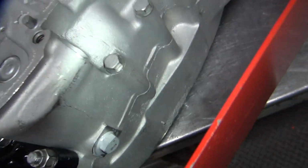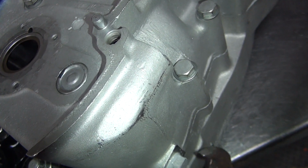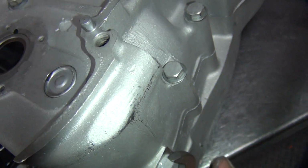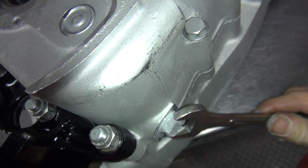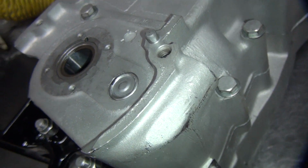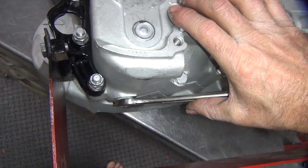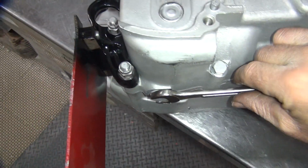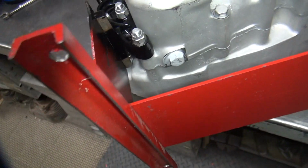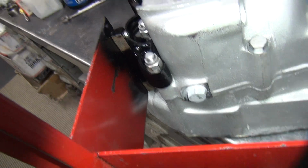You can see better when I come over here. So I just come from underneath here, the box wrench on here. Like that. Come up from the top, up this angle. I'm going to put a little pressure on there. A fair amount of pressure, but not super tight, but it's tight. A good 15 foot-pounds on there probably. Alright, so that one's all in there.